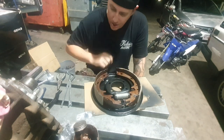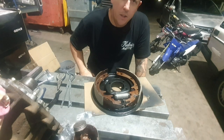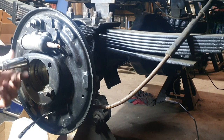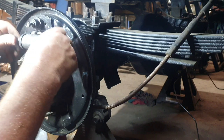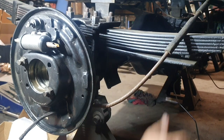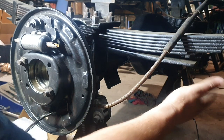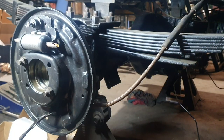Slave cylinder's in, handbrake lever is on — that means we're ready to go to the car. Because I don't have any axles in here yet, I'll just put two bolts in to hold the backing plate on. Handbrake cable has run in. I've run it over the top of the spring — it used to run under, but I've decided it should run over. I think that's where it's meant to go. It sits better there.